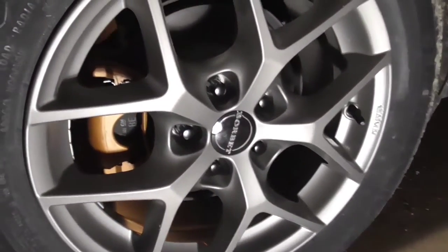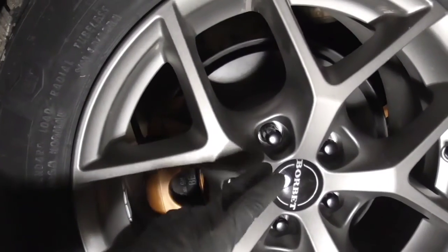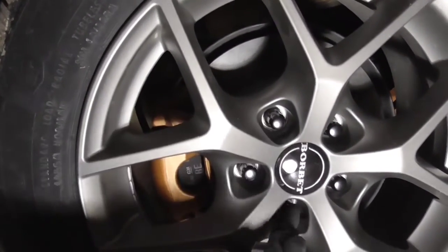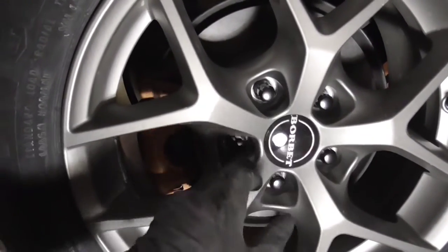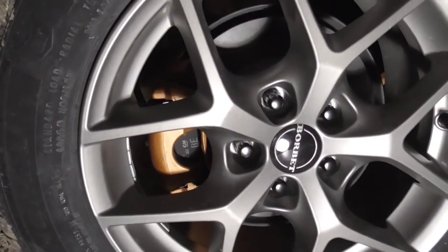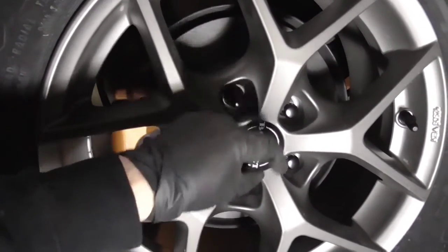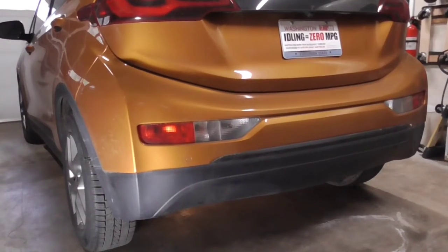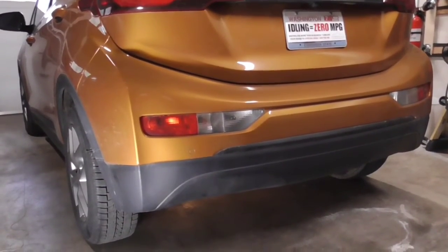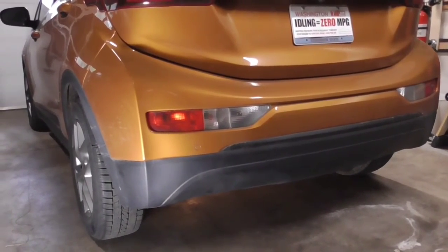If your car is out of spec, the procedure is basically the same as for camber except instead of doing the two top bolts you would do either the two front bolts or the two back bolts depending on whether you're toe-in or toe-out. The final step is to tighten your lug nuts to 103 foot-pounds in a star pattern. After that, drive it for a hundred miles, come back, check it again, and retighten if needed. And that's going to do it for this video — hope you guys enjoyed it, please like and subscribe if you did, many more videos to come.